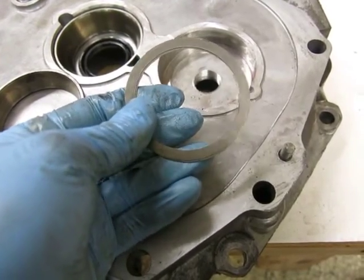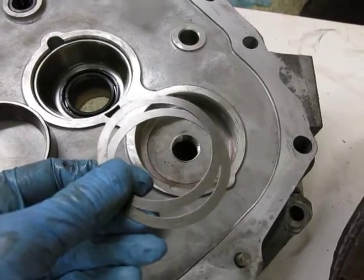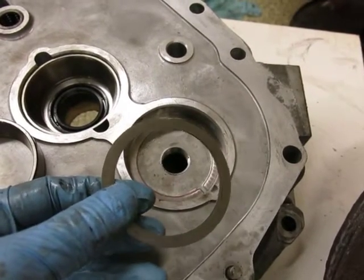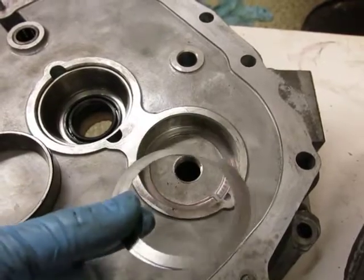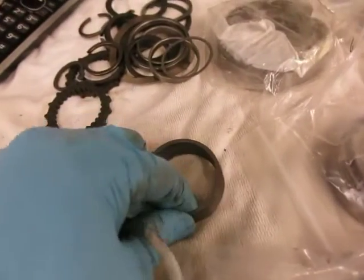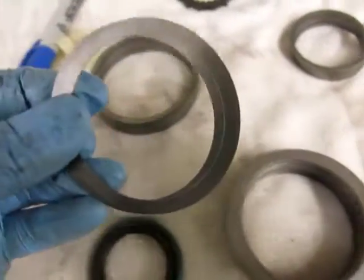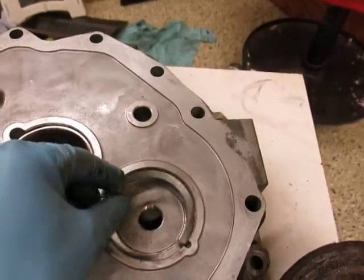I realized that in my head I was thinking I wanted to target 3 mils of preload. Even though the book specifies 2 mils of preload, the recommendation from many experts is to go a little bit on the tighter side — so in my head I was thinking 3, which is where my math came from to get to 31. Here are the shims for the countershaft, here are all the shims for the input shaft, and here are the shims I believe are for the countershaft extension. I found two shims that together give me 30.5 mils of shim thickness, which should give me about 2.5 mils of preload for the countershaft.